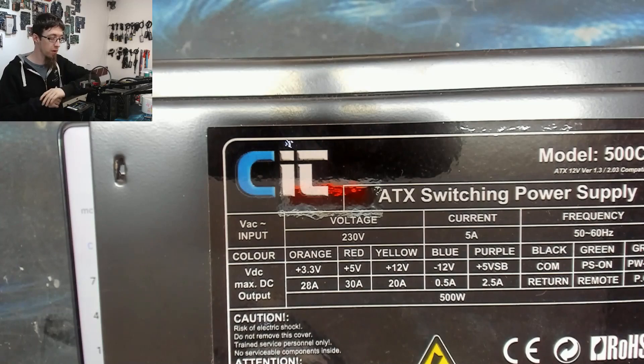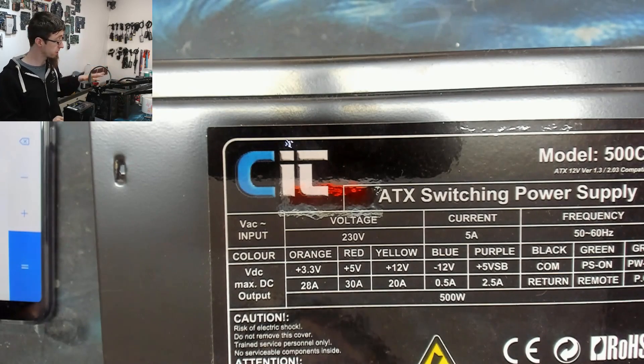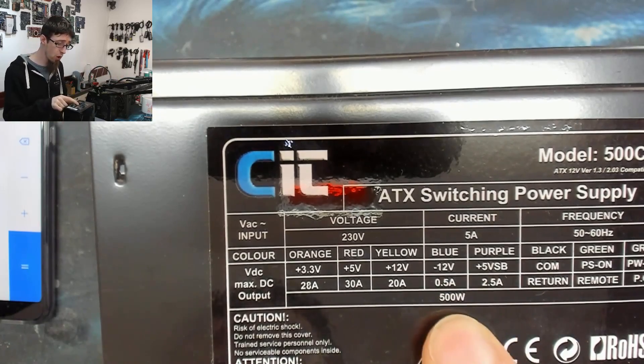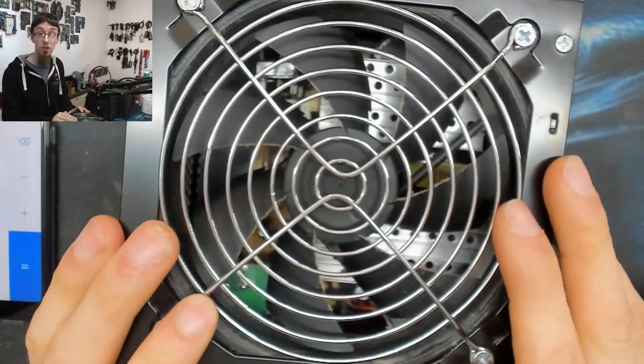So that's how you look at power rails and judge your power supply. If it's delivering around 75% of the rated wattage on the 12V rail, like some Corsairs, that's not the end of the world if that wattage is enough — the VS 450 still does 400W on the 12V rail, which is fine. However, if you've got a 500W supply only doing 240W on the 12V rail, that's a serious problem and that's why these cheap supplies are garbage.